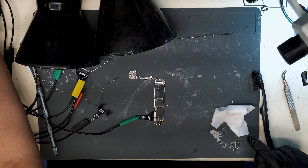It worked, but we've got no touch. Touch should start working — it looks like a separate board issue. That's common on the 8 series — a problem with one of the pins on the home button FPC connector. We can talk about that in a future video. After disconnecting that, we've restored our touch functions. Touch is working, and it looks like we do have a path to data on this phone. Job complete.